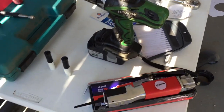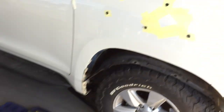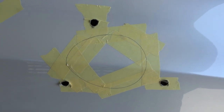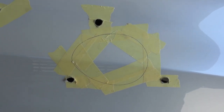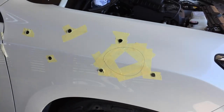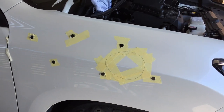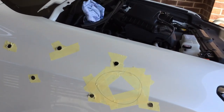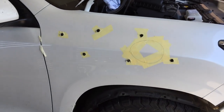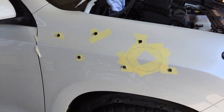The next step is to use the air saw for the first time and cut out the large hole. It says to drill two or three 10mm holes first — I'm just going to start with one and see how it goes and work my way around. Then the ugliness is really over, provided it all winds up good. I've literally only been going about three quarters of an hour so far.